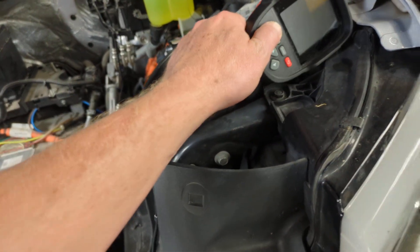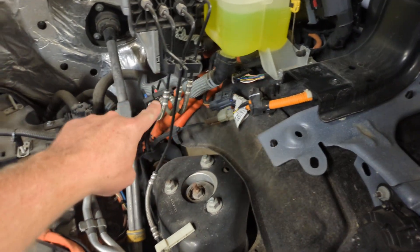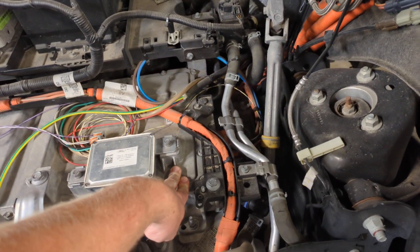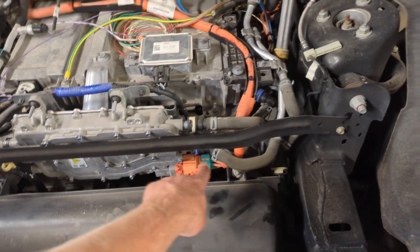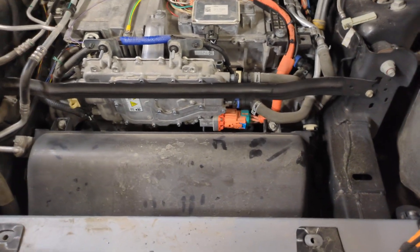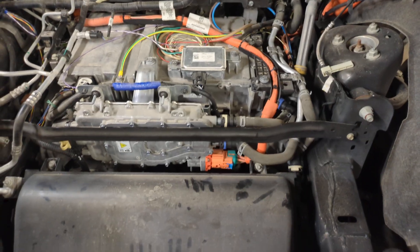I've got a thermal camera here, I'll turn it on, but I'll talk a little bit about how the wiring works. The charge port is up here; the power comes in and goes right down here into the AC power into the onboard charger, and then DC goes out the back. For some reason Ford has routed the high voltage DC all the way around here into this DC-DC converter and then back out to the battery auxiliary port. The only reason I can fathom they did that is they put a four-pin connector here, basically making a junction within this module so they don't have to have a high voltage DC junction somewhere else.